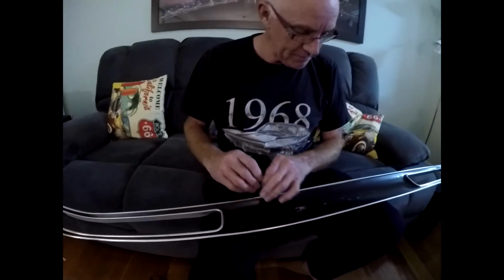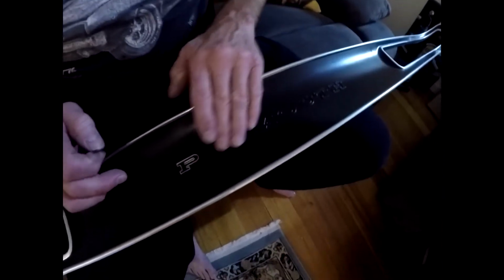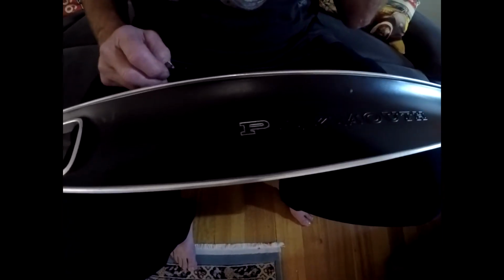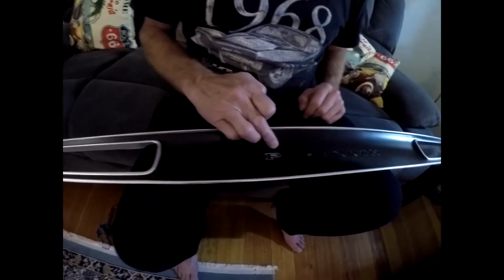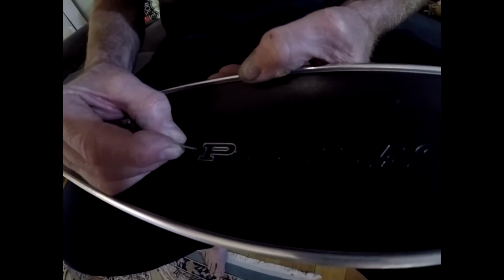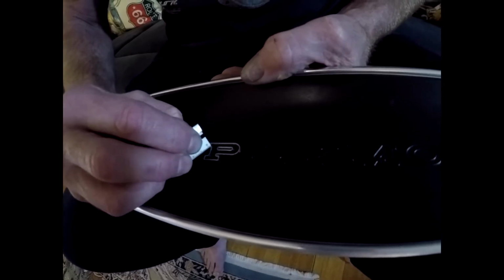Now, as well as that, I've kept this for a separate job. So this lettering back in the day would have been screen printed in some way. I don't know how they would have done it, but some obviously mechanical way that was fast. I couldn't think of any easy way to isolate that from paint. Certainly couldn't do it with fine line tape. So I etch primed this first, then I painted the satin black on it second. Now I'm just going to use a regular old blade, and that's what I've just done here, and carefully scrape the paint off, watching every stroke you do, and recover the bright aluminium behind it.